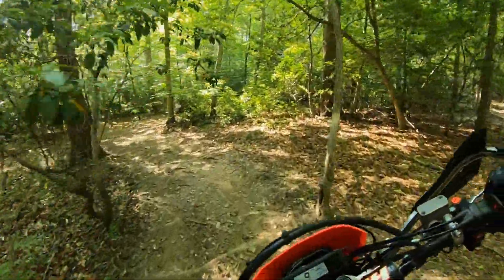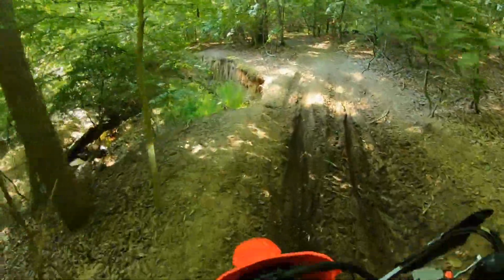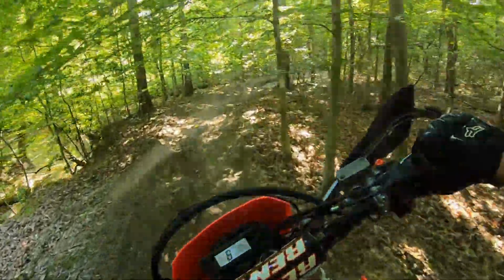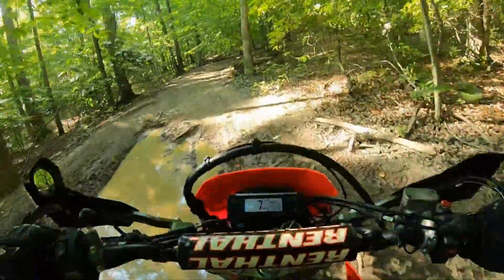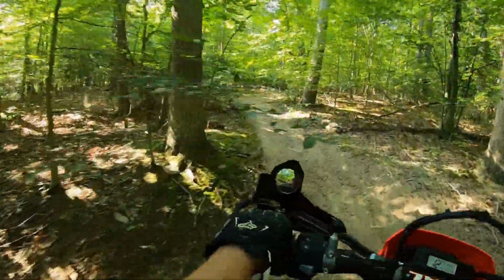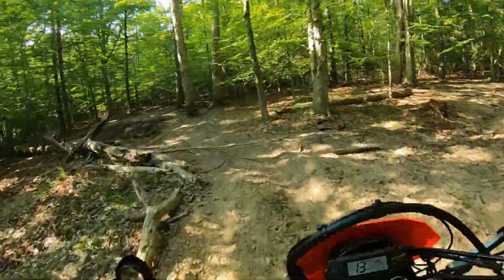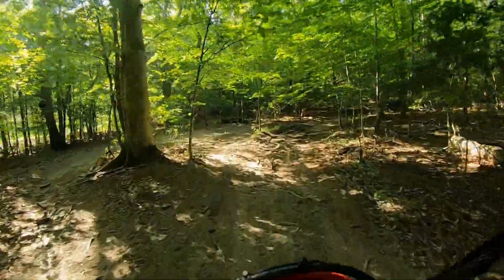Yeah, so it's got the Tokyo Vortex ECU in it. The low, mid, and high settings are all at 555. I haven't really done any reading about it yet, but hopefully I can touch the tune up just slightly and make the stalling issue less of a thing, because I'm sure any of you watching this just for the 450L content have heard over and over about the flame out issues, whether from Tension Deficit or any number of other channels.